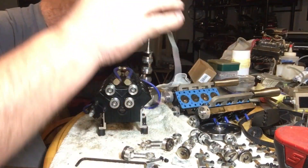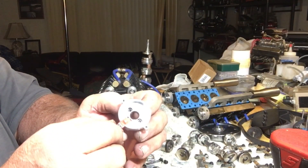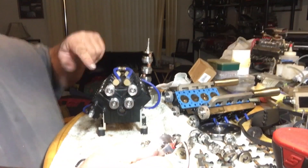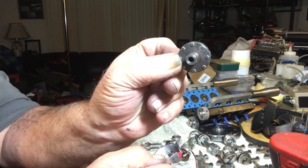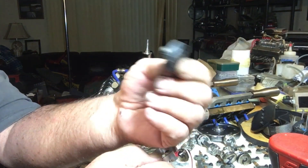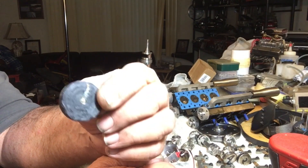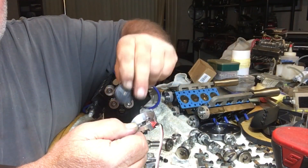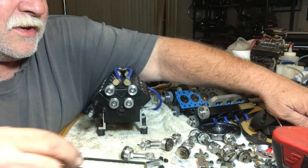Here's the distributor itself — it just bolts onto the back of the block with two screws. I wish it was adjustable so you can tweak it a bit, because right now you have to follow the blog instructions to set the timing on it. This is your trigger wheel here — this is the back side — and it has a couple of grub screws and mounts to the back of the camshaft. This one had come loose and kind of glued itself to the distributor cap, so you'll see some scrapes on there, but it still kept running. That goes right inside there like so, and that's your hall sensor for your CDI. Everything so far is working very well in this thing.